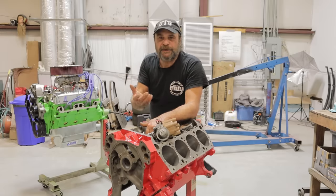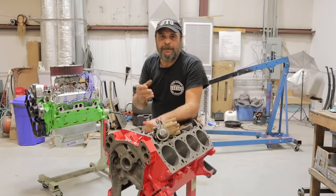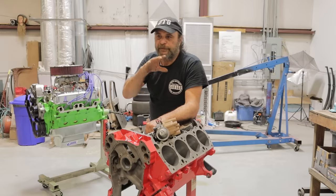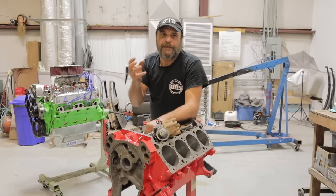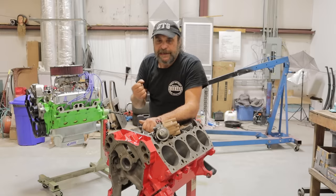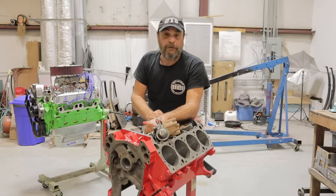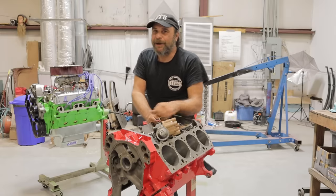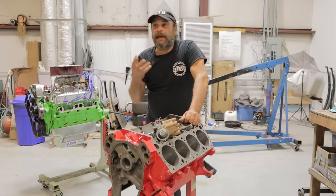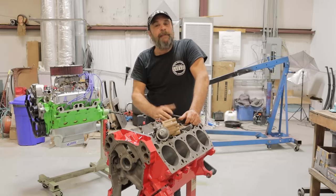When I was 16 I didn't have a timing light, so I did everything by the seat of my pants. People would bring me their cars and I'd give them a tune-up. I had read in one of the magazines — Hot Rod, Car Craft — about advancing timing and how ignition timing was set from the factory for emissions purposes and smooth drivability. So when I did a tune-up — change the plugs, cap, rotor, points, condenser — I would take the distributor and give it just a little pull to advance it. Give the car back to them and that car never ran so good. I was flying by the seat of my pants, but I was power timing.